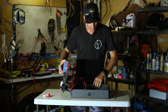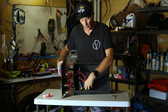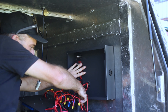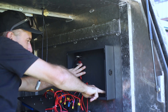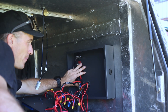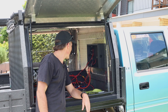Next step I need to do is drill a hole in the back here. This is where my cables are going to come from — the starter battery. The way I'd done it originally was pretty messy, so I want to get it all hidden inside this box. I've found my location and I'll drill it now. I've got my leads from the starter battery coming through. I should drill four holes into this box so I can bolt it onto the canopy — that's going to really tidy it up. I'll take this off, mark it up on the canopy, drill those holes, and bolt it in. The control box is mounted — now time to start running some wires.